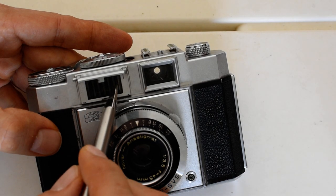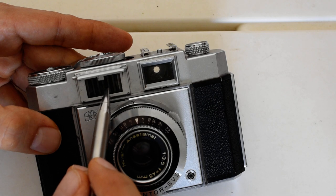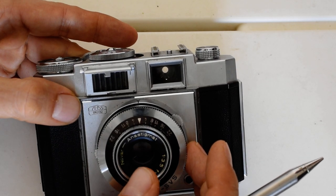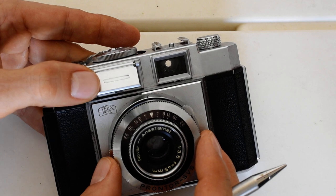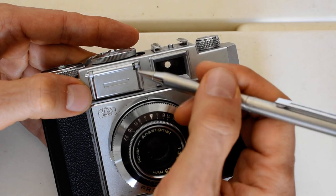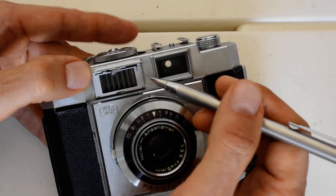These old light meters made of selenium did not require batteries — that's an advantage. The disadvantage is that they weren't particularly good in low light, and once the selenium is exhausted — if you leave this out in the light for long enough — you've got a dead light meter and there's nothing you can do to bring it back. On this model, the flap contains a small indentation that is purely decorative. On the other version I mentioned, there are two holes here which restrict the amount of light reaching the sensor for bright-light metering, with low-light metering when flipped open.